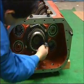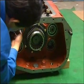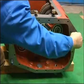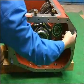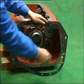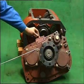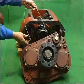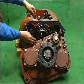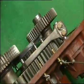Coat bearing 42307E with lubrication grease to prevent the balls of the bearing from dropping. Coat the two locating pins on the housing with lubrication grease, which is good for installing the rear cover of the auxiliary case, and add a gasket. Use a special clamp of the rear cover of the auxiliary case to set the auxiliary case synchronizer at the low speed position.